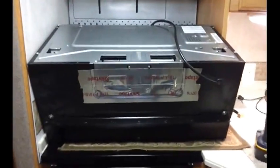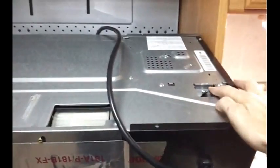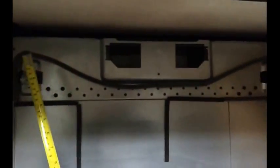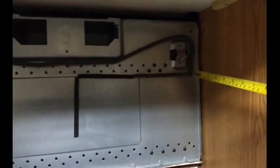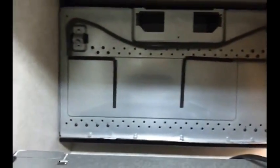We tried putting it in there and I realized part of my problem — the reason why those big long screws weren't lining up. With a little effort I was able to get one side to hook and catch, but I never could get the screw on the right-hand side to catch and hold. So I took it back down to see what the problem was and figured it out. Once again, from the factory they've installed the back panel a little bit crooked — there's a quarter inch difference from one side to the other. Because this side is a quarter inch higher, when I put the microwave in and tilt it up, the microwave is hitting the roof before the bolt can reach the anchor point. So I've got 11 screws to take out, I will drop that one side down a quarter inch, get everything nice and level, redrill some new holes, and put the screws back in. Hopefully it will work like it's supposed to be.